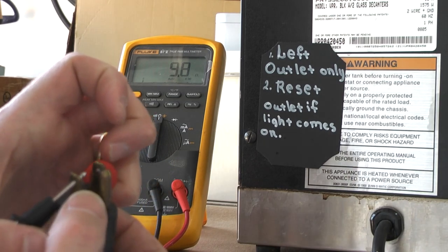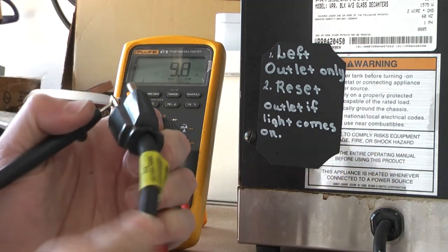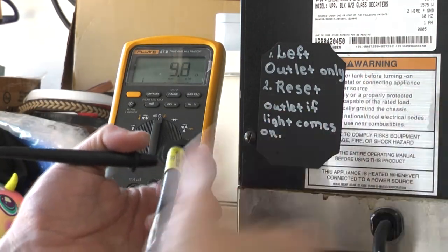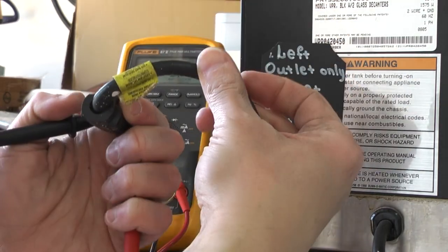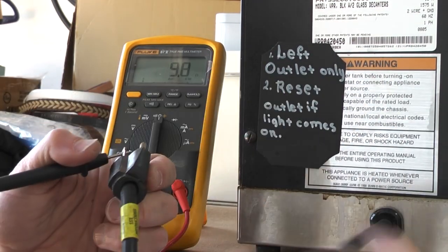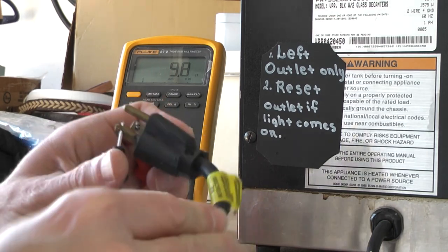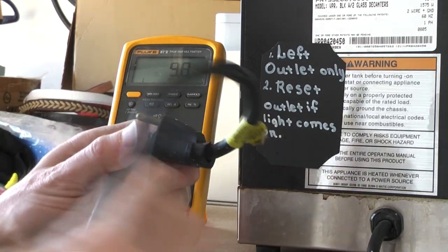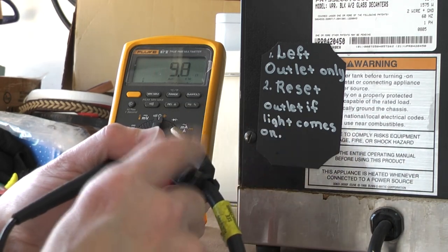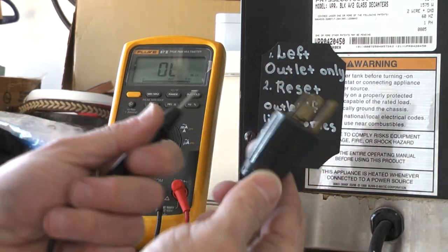Measuring just the outlet here, just the two pins of the plug, and moving it around — 9.8 ohms. It's normal for a standby unit, meaning nothing is actually running, no heat resistance and whatnot. I can't detect a short, because if you move around the cable to see if there's any shorts, the multimeter would get to 0 ohms or something like that. There's absolutely no problem there. I don't think there's a real trouble with a short inside the unit itself, although the outlet could be causing the problem because it may be sparking. The unit itself is not shorting, which is a good sign, but this outlet is very charred — it needs to be changed anyways.